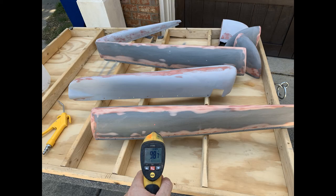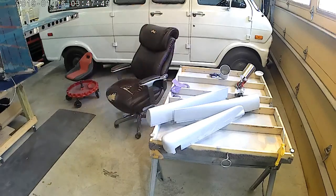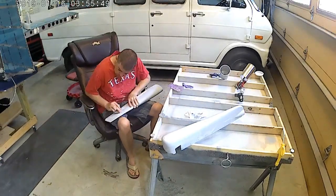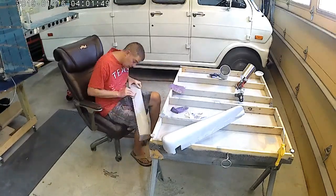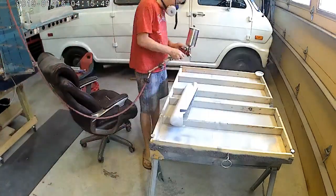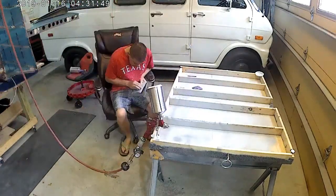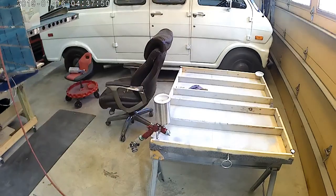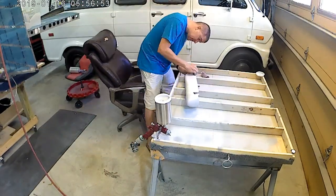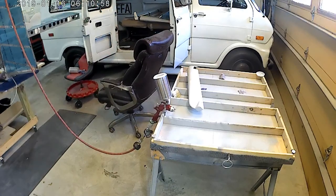Stuart System says to paint between 70 and 90 degrees — I was 8 degrees over. I don't feel like that was the reason for the orange peel. They also say you can dilute by 10% distilled water, and I did that. I was using a 1.8 nozzle without it diluted, then went to a 1.4 nozzle with it diluted, which is exactly what they say to do. It required a little bit more high pressure than what I'm used to, and everything seemed to smooth out after that. I have no doubt it was all user error and no part of it was the Stuart System paint.